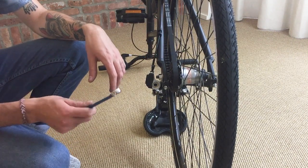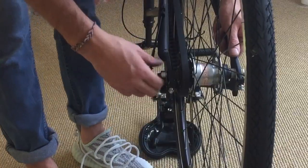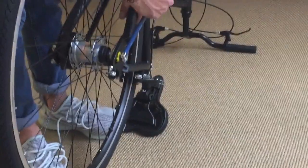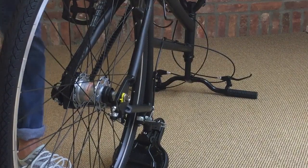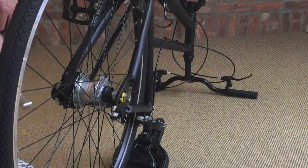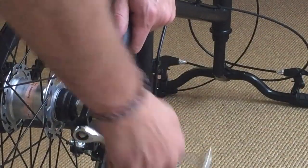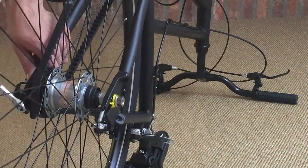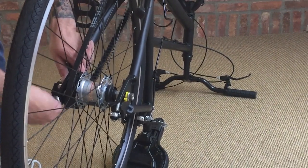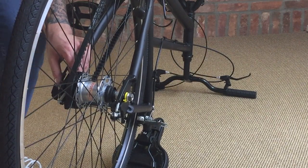And from there, we can grab our 15mm wrench and start to undo our axle bolts. Once it's loose, you can kind of just undo it with your hands. Same for the other side. They don't need to be completely taken off the axle itself. Then from there, we grab our 10mm wrench and start to undo the belt tensioners. And I like to take these completely off so you get the most amount of slack in the belt. Put those to the side so you don't lose them.